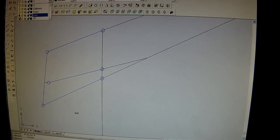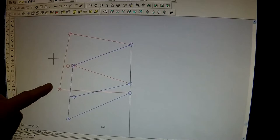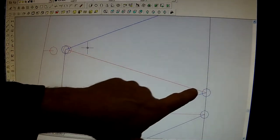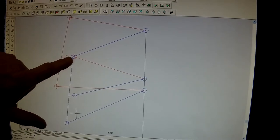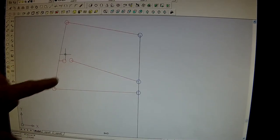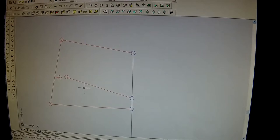Here's the suspension in the compressed position. You can see a little bit of negative camber. The red line is my steering rod — the rack is here, coming up, under full compression, which is an extreme example. You can see my pivot points are way off — almost an inch off on this drawing. That gave me about three inches of toe-in on full compression on each side, which was totally undriveable.